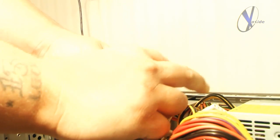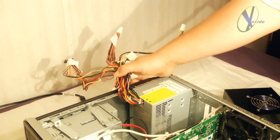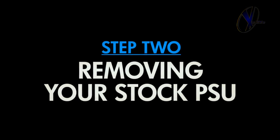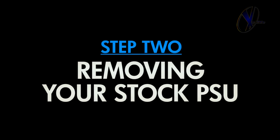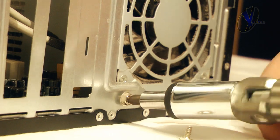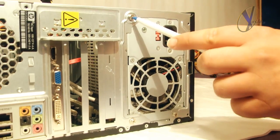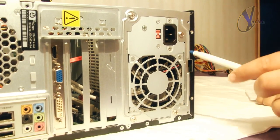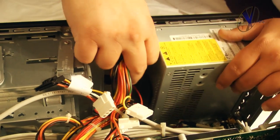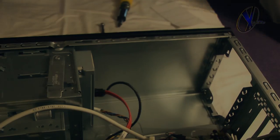That's very important. If you can lift the entire grouping of cables up from the case, you know you got them all. Once all the cables are removed and the components are clearly marked, start unscrewing the power supply from the back of the PC. The power supply generally uses a four-point screw setup, so be sure to remove only those. After the screws are out, the power supply should easily snap out of place. Now slowly remove the old PSU out of the case and set it aside.